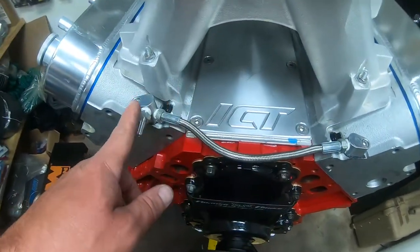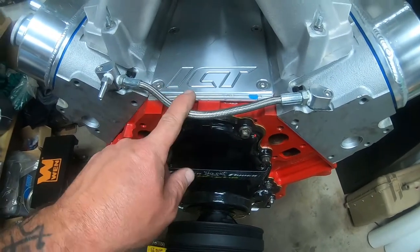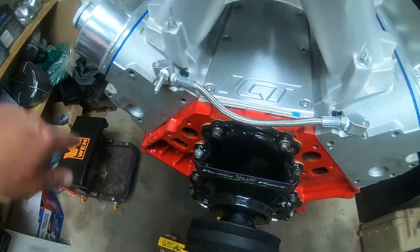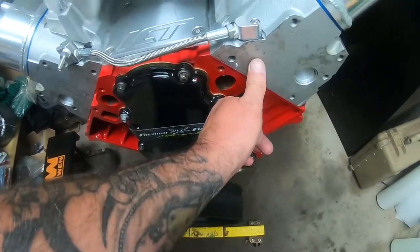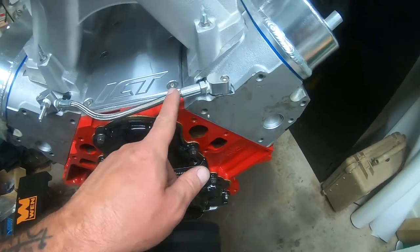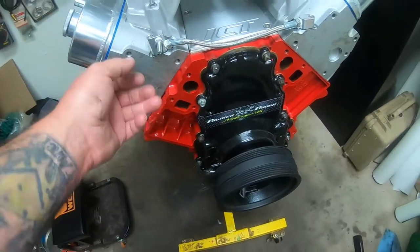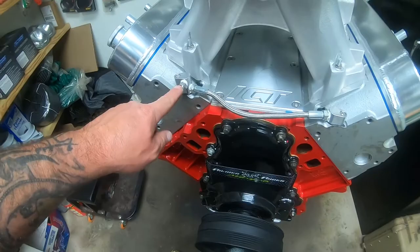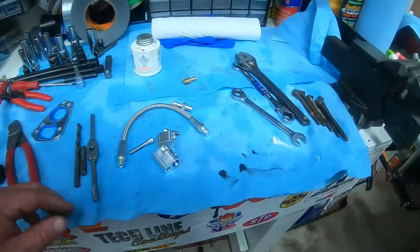It's going to circulate, not really water. It's going to bleed off any kind of extra steam and whatnot. That's what's called a steam vent. And then you'll connect this to your water pump. So as the water pump's turning and water's rushing around, what little bit of bubbles there are, because air rises, goes to the top of the head. It comes up through here as steam vapor. And then your water pump will take it and push it to the top of the radiator. So that's why we're only doing it on the front. I don't really have to do it on the back, or I've never noticed any kind of deal.